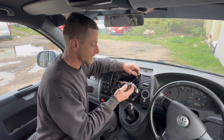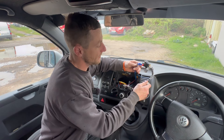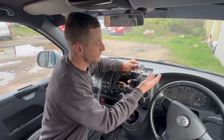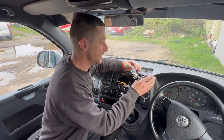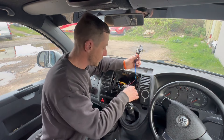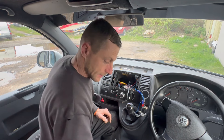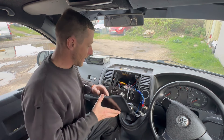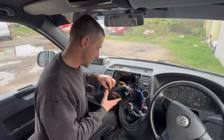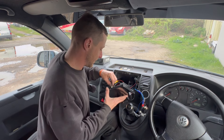The sub and amp wires come as a pigtail. To keep the wiring loom as tidy as possible, any wires I haven't used I've just run a bit of black tape around. If you think you're never going to use certain wires, cut them off - it makes the wiring loom behind the dash even tidier. Let me plug it all in because I want to quickly show you how it works. For the money and how it fit, I am very impressed.